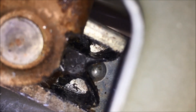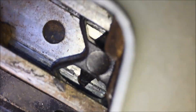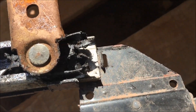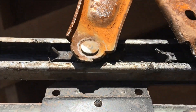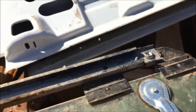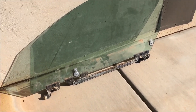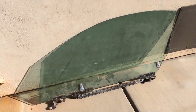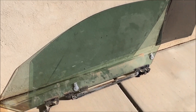We just want it to come out at the end, since it's meant to keep the glass from coming out of the track. These pieces are supposed to compress, and we have the window halfway out the door now. Slide the ends of those out of the rail and the window is free. Now at this point I don't know if it would have been better to just drill out the rivets and keep the frame rail as one piece — you'll have to decide which method is better.